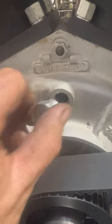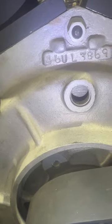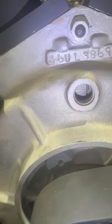Now you're going to remove your timing hole plug. The timing marks will be different for different engines. This one's going to be a straight line. There it is.